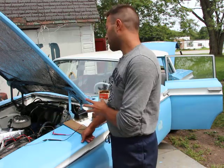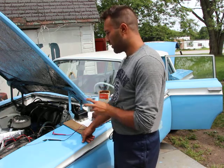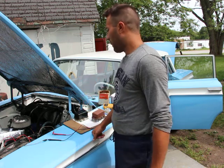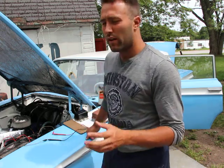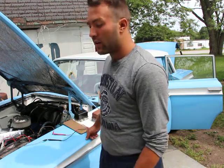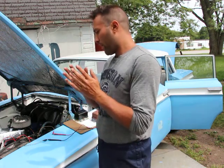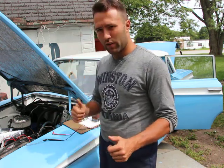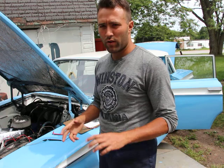So one thought that I had is that the car was hard to start because of the rebuild, that the engine is too tight once it's hot, okay? But what was happening is, if I waited till the engine cools down again, then the car would start up pretty much fine. Not as well as the first time. So once again, basically, I could start the engine cold, fire it up, no problem. Start it hot, it wouldn't turn; wait till it cools, and it starts all right.